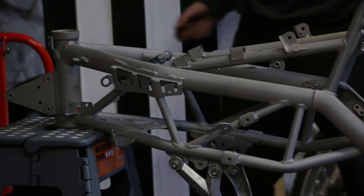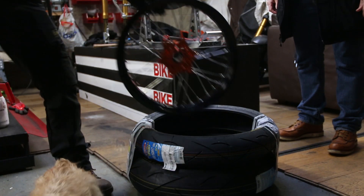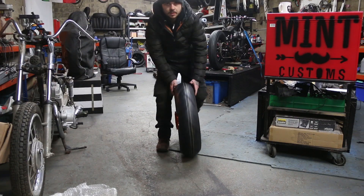All the parts are starting to arrive, so I decided to start throwing it all together to see what would fit and what wouldn't fit. I had the yokes machined so the Ohlins forks would fit in the yokes. I measured the front wheel so I could make up some wheel spacers, and measured the offset on the discs so I could make some spacers to get the discs fitted. And measured the calipers so I could get the calipers machined so they would fit the discs without hitting the spokes.